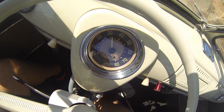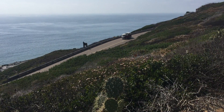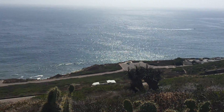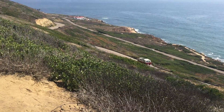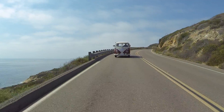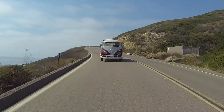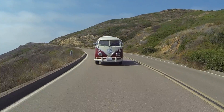Fourth is really just for the highways. In the future, we're going to start using a two-speed transmission and have even less shifting. First is really only necessary if you're on a super steep driveway or something like that. The range in this build is about 60 to 70 miles, and we're just starting to use Tesla batteries in our builds, so future buses are going to go further. A lot more room for more batteries in the bus.